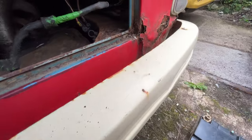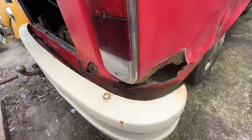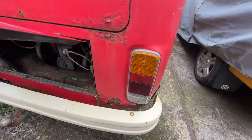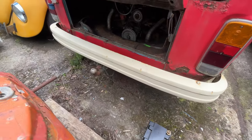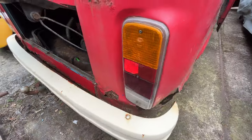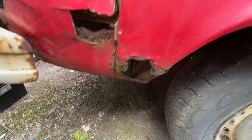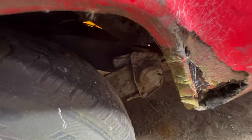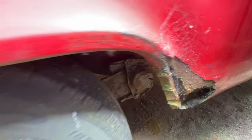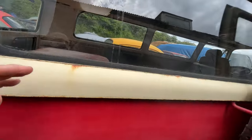Bumper's all good on this side. The lower quarter has gone — needs a lower quarter panel there. Bumper is good and he's got a tow hitch. On the other side he's going to need an arch repair there — this is solid on the top lip, but get the repair panel and cut the two ends.